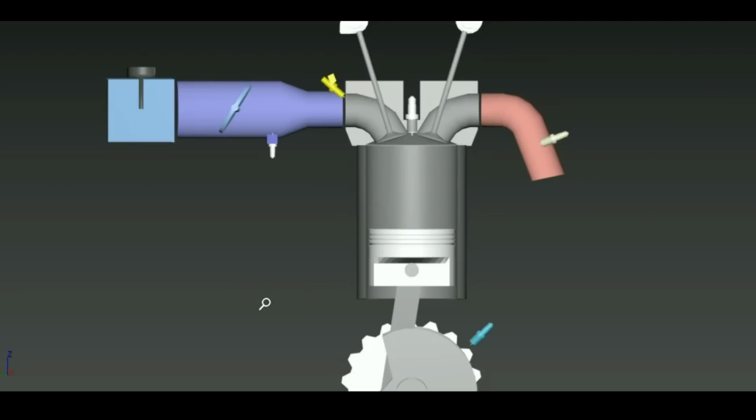And usually in production car engines, that peak volumetric efficiency that they tune the cams and everything for is around 4000 RPM, the mid RPM range basically. But in racing engines, it's quite the opposite. They usually want to maximize their volumetric efficiency at a much higher RPM, because on the track, that's the range that the engine is always going to be running at. It's never going to go to that low RPM range, which is important for production cars, but it's not important for race cars.